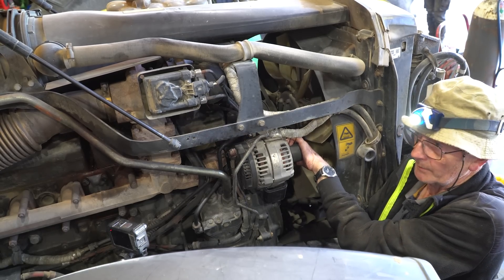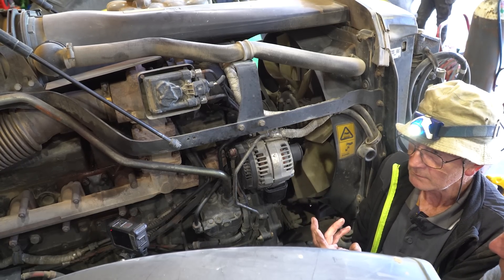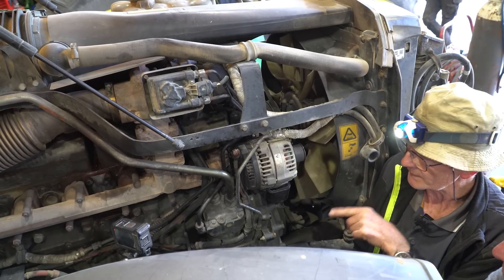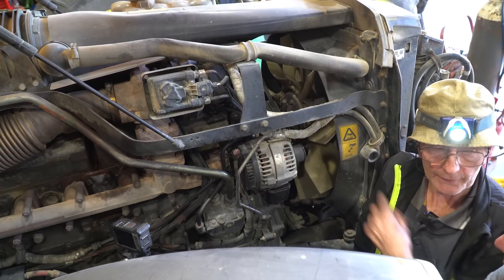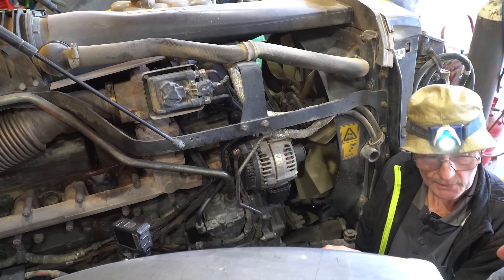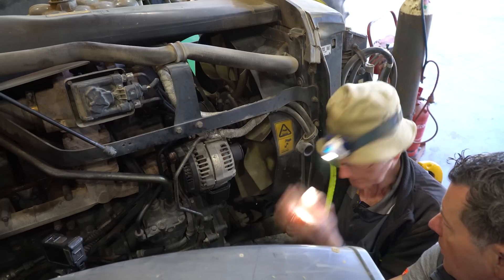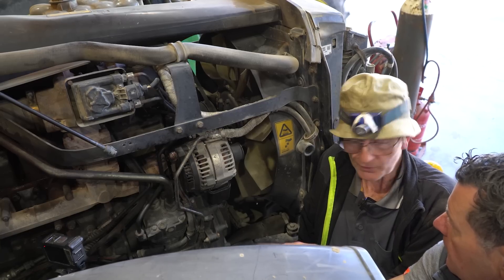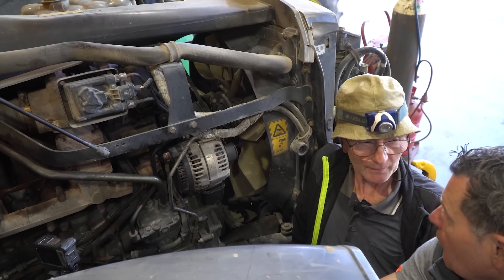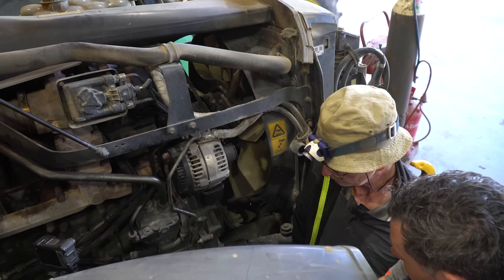Sean tested the alternator there and then and rang back - nothing wrong with it, which I half expected. While it was away, the bracket was broken so we repaired and welded that up. When I was testing the wire while it was away, I was only getting four volts, and before it went away the voltage was disappearing down to zero - I was thinking maybe this was ECU controlled. Put it all back together, battery fully charged, started up - straight away on the dash, 14.5 volts. The ECU had presumably switched off to limit consumption and protect circuits. Battery is now fully charged and she's back on the road.